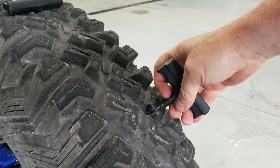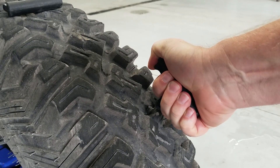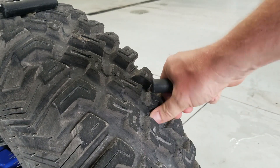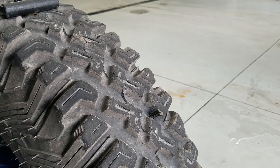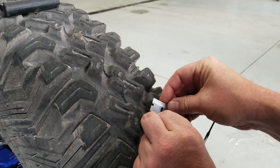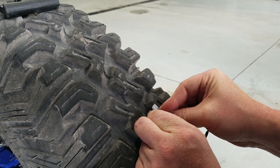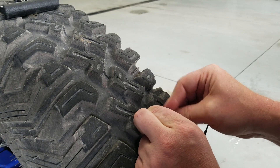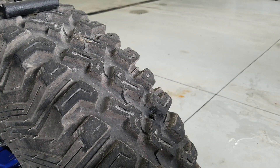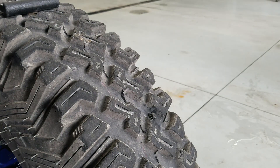Push it down about that far, we'll trim it. When you pull the plug tool out, you just want to do it fast — just pull it right out. There you go, she's fixed! Grab some tools, we'll trim that. Leave some but you don't need too much. Take the blade and leave a little — there you go. Get that tire pressure back up, but plugs are awesome. You gotta have plugs on the trail.